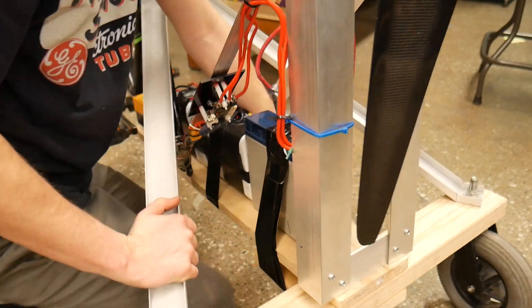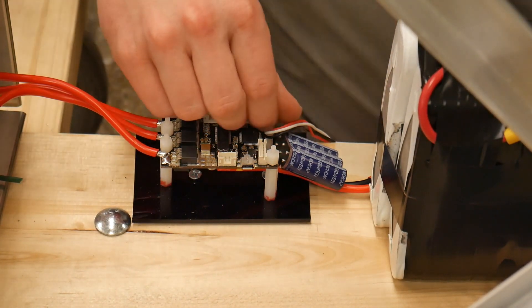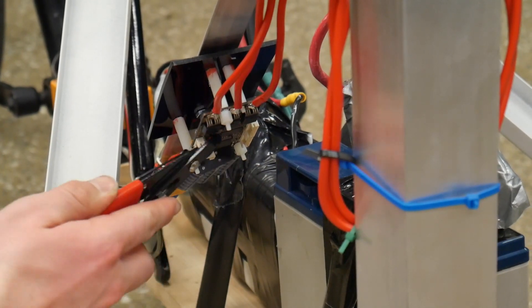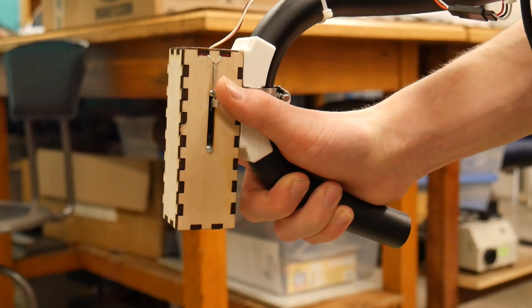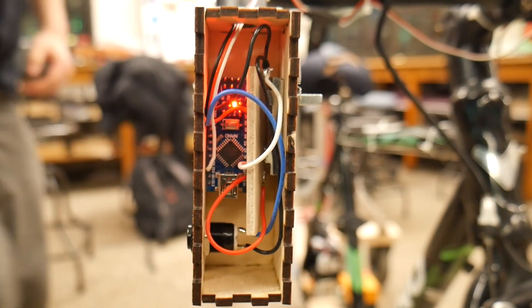It was a nickel metal hydride 30-volt battery. The next thing was to hook up the VESC. I didn't want it just hanging around where anything could short on it, so I cut out some pieces from plexiglass and mounted it to one of the aluminum rails holding up the motor, in a stable place where it would get good airflow from the fan. For the human control system, the VESC has a very useful wire that provides 5 volts, ground, and accepts PWM input, which made it easy to create a throttle device to mount on my handlebars. This was a perfect job for an Arduino.